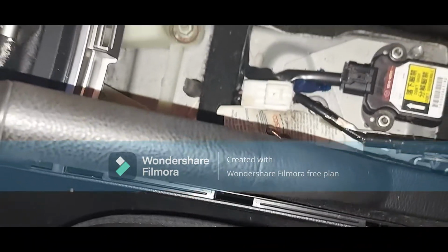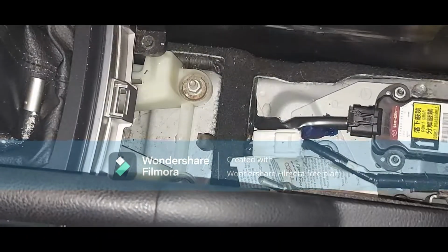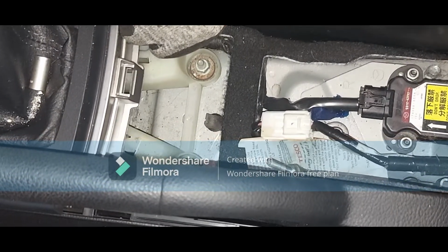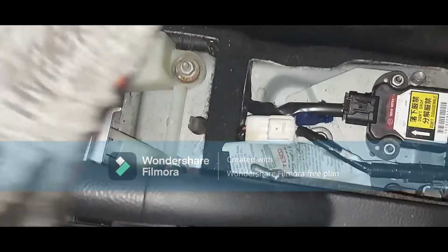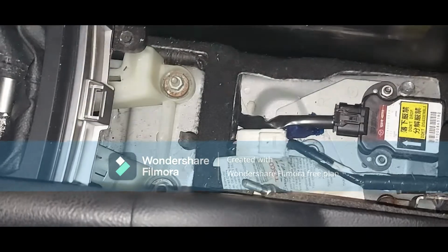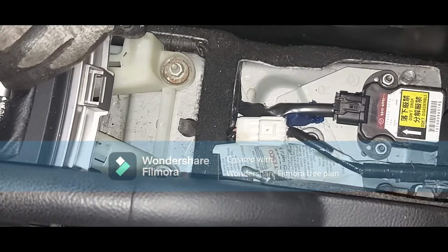So what we're going to do now, we are going to go to the wheels. We release the handbrake, and then we go to the wheels. We turn the wheels by hand and see if the wheels are free. If the wheels are free and we've got 5 clicks here, maximum 6, I'm happy with that. That passes MOT okay. It's not too loose, it's not too tight.